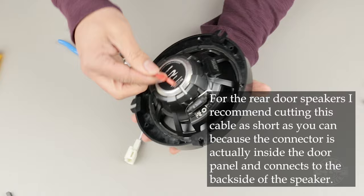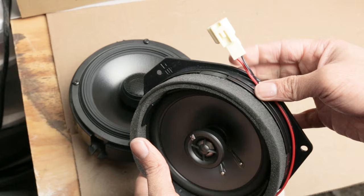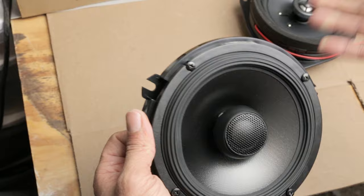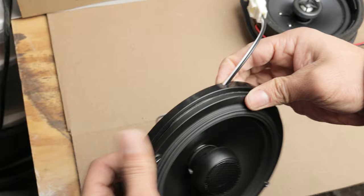You may have noticed that the OEM Kicker upgrade has the cable already on the outside of the speaker, because the cable on the car is also on the outside. The speaker brackets I got did not have that access hole because these are universal and meant for different types of cars. Luckily it's pretty easy to fix — I used a drill and drilled an access hole right on the side roughly in the same spot that the OEM Kicker upgrade had it. Now the cable can sit right there and doesn't have to be pinched on the outside. It might be something you want to do before you even put the speaker in there.